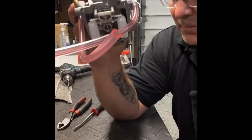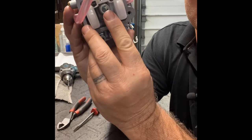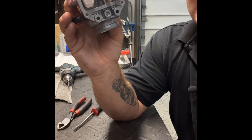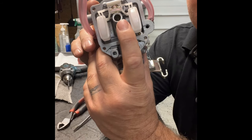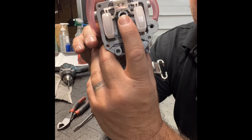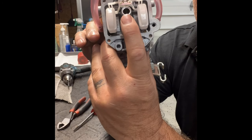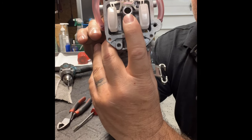The other obvious place is your main jet — typically around a 190 or 195. The main jet regulates fuel, so to increase head temperature at the finish line, go smaller: down to a 180 or 185. That leans out the main circuit and increases your head temperature.